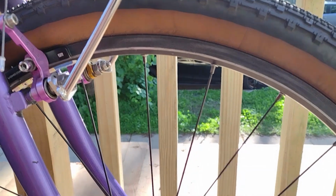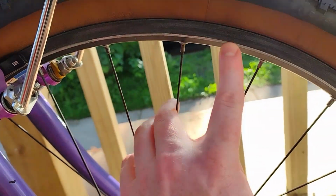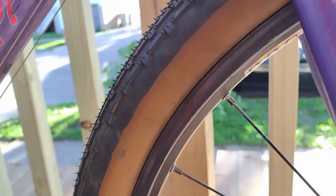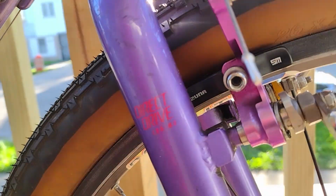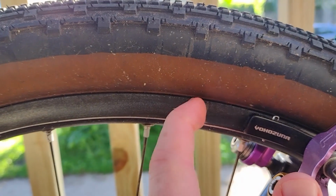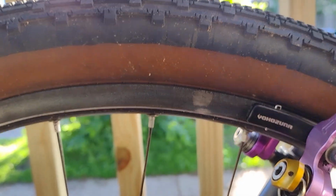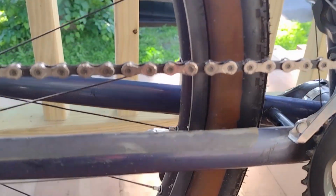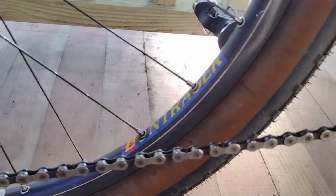I picked up this very used set of Bontrager Race Light wheels for cheap. Like the name suggests, they are fairly lightweight, and they are tubeless compatible rim brake 26ers, which are kind of rare. They have a ceramic coated braking surface, which requires the use of special brake pads, and that ceramic coating is worn and chipping away, resulting in a very uneven braking surface and like bare alloy in some spots. Braking feels bad and sounds bad. These rims are not long for this world.